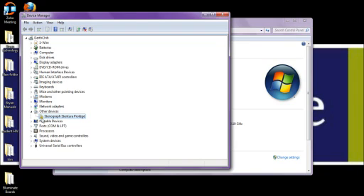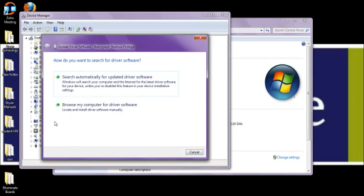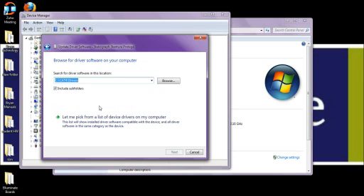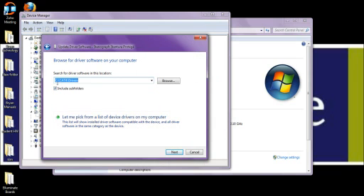We simply need to install the drivers. We will do so by right-clicking this line, clicking Update Driver Software, then Browse My Computer for Driver Software. Click on Browse, then go into Computer, your C Drive or Local Disk C, then Cat4, then Drivers. Once the Drivers folder is highlighted, click OK. That will place in the extension C:\Cat4\Drivers.